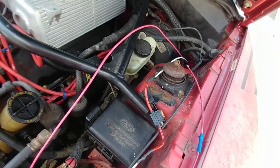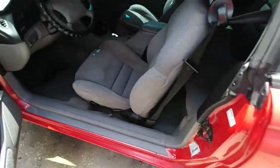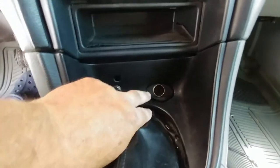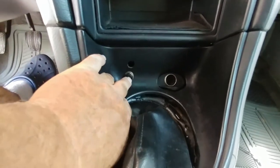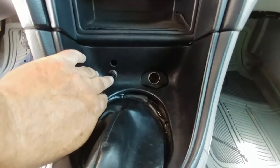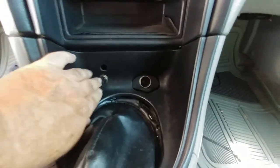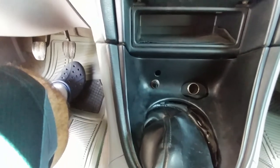You can see where I put it in. You'll see there's a white wire coming out with the 20-amp fuse — I'll explain that here in a second. If we go inside the car, the switch is here. It's a single-pole double-throw switch mounted next to the cigarette lighter, which it has to be low like that because I drilled high and it wouldn't fit — there's a metal bar behind that, so there's space. It goes in the curve of the bezel. Once you put that in there, lock everything in, solder the back of it. The middle of it is where the power line goes. The two reds on the outside — I've got the right side being the low side, and the high side is the left side.